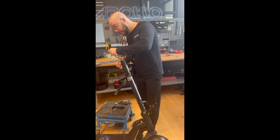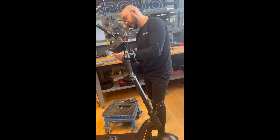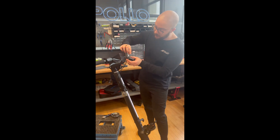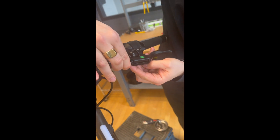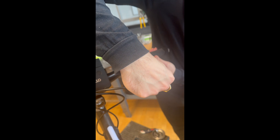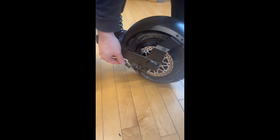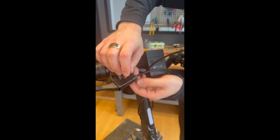Put the cable back and put the headset back in place. Put all the wires inside — always be careful not to pinch anything, it's a very tight fit. To remove the brake cables, align the spline and pull on the cable while pressing like this to take the cable out. You might want to loosen it at the brake caliper if it's too hard to push.